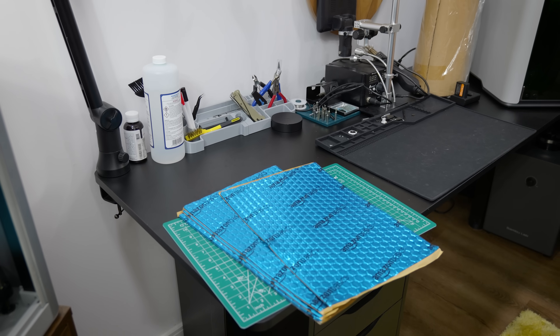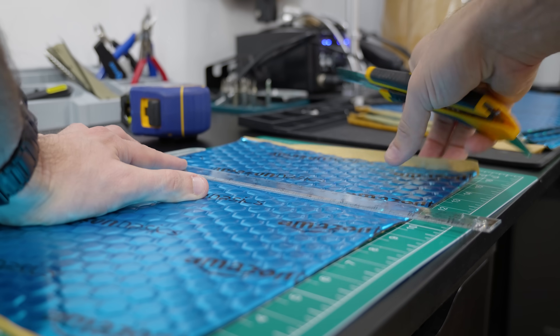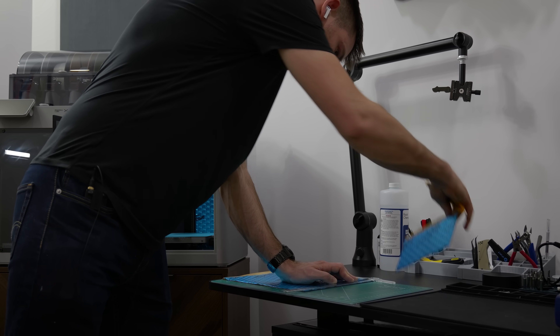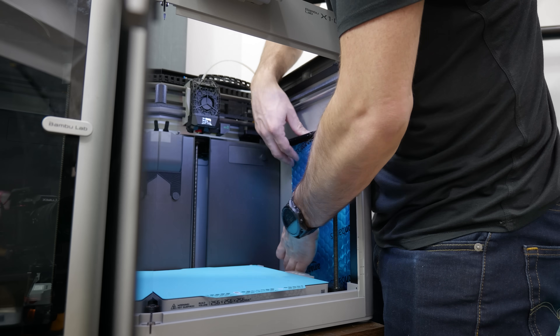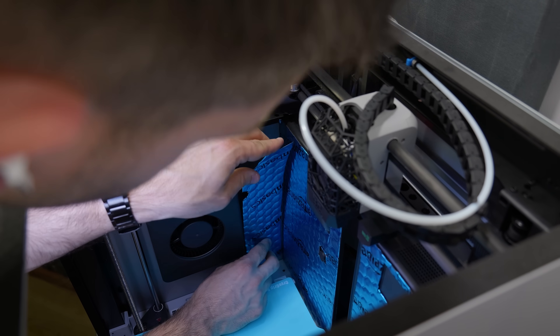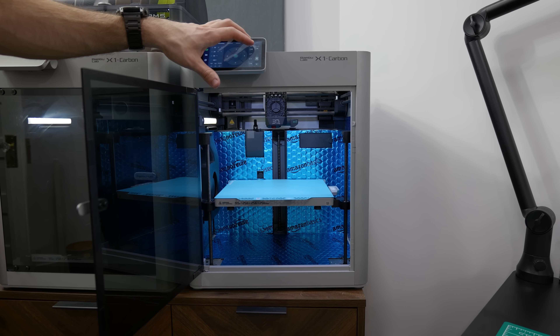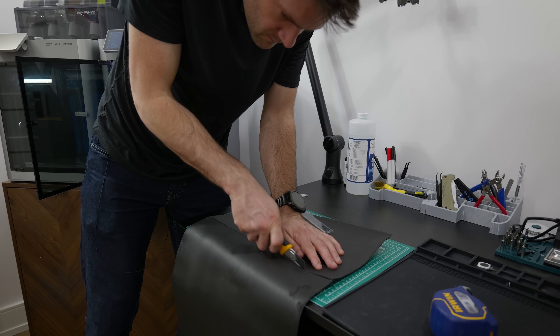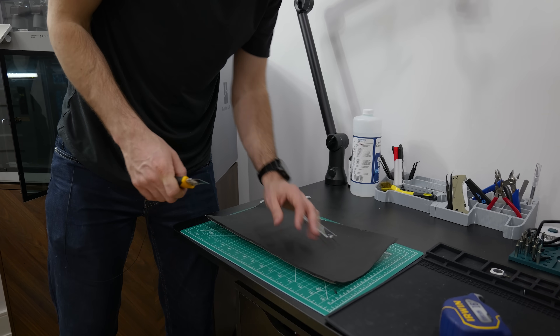And speaking of peaceful silence, let's get back into this next mod. This is butyl rubber — if you've ever seen any of my speaker projects, you might know where I'm going. This stuff is great at absorbing vibrations and deadening sound transmission, widely used in the car world to isolate cabins from road vibrations. My hope is that it will make the printer quieter, but that's also just a side benefit. Installation was a little tricky because some of the clearances inside the printer are quite tight, so make sure all moving parts still work. Then on top of the butyl rubber, I'm layering on some closed-cell foam.